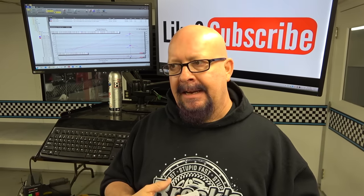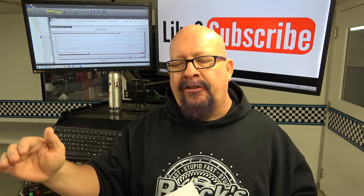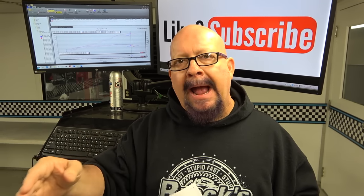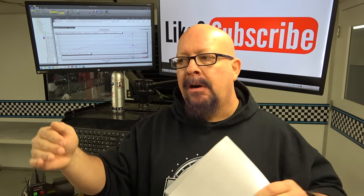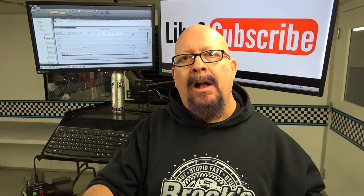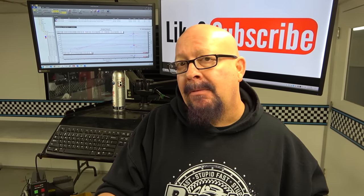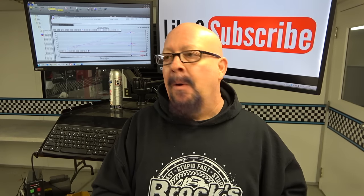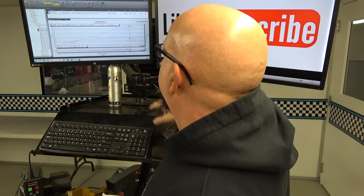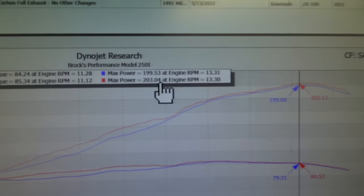Well, as an exhaust developer, we can go and change where power is. We can actually create it better in certain areas because I can lengthen a secondary collector because I don't have to worry about a catalytic converter having to be in there. This is race stuff. So when we put on the pipe, did we pick up a bunch of peak horsepower? Well, no, it says right here, we went from 199.5 to 203.